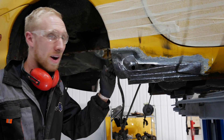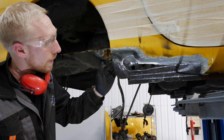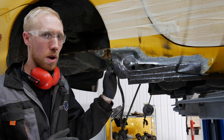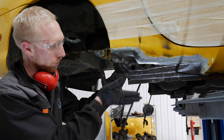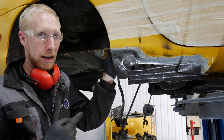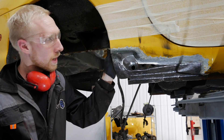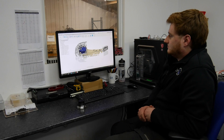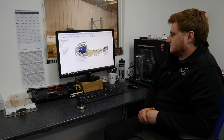It's actually come out fairly well. I cleaned it all down and as you can see it's pretty shiny now. I'll go over it a couple more times with the wire wheel and then etch prime it. I've had to cut a little plate out on the back of here, so this will be put in after - it'll just rebuild this section. Right, now we're going to head upstairs and see Josh, so we'll come back to this on episode 4.